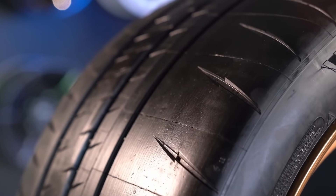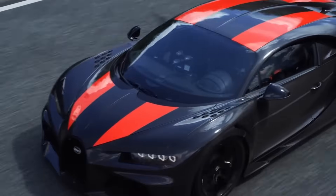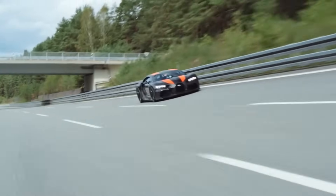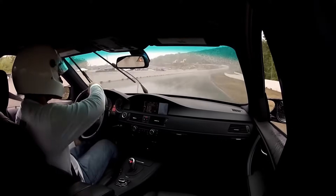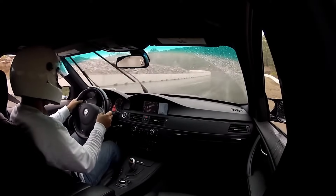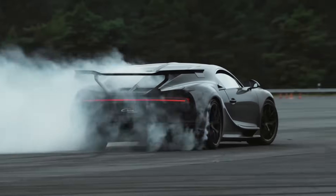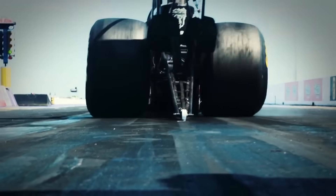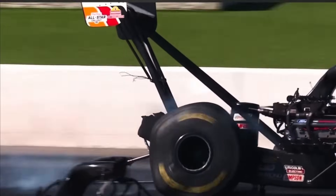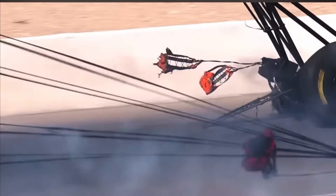This is what makes those Michelin Cup 2 tires — the same ones that allow hypercars to reach speeds like this — pretty bad tires for everyday use. Building a tire this durable comes with a load of problems. Beyond not being able to get the Cup 2 up to temperature on the street the same way your regular commuter tires will, if you get caught out in the rain with them they're outright dangerous. You need to make sure the tire remains usable for all kinds of road and weather conditions while lasting a reasonable distance. If Michelin designs a tire rated for these speeds, they need to make sure it can do it more than once — it has to be able to go this fast again and again. A completely different challenge than that faced by Goodyear when designing these giant one-off tires for dragsters, where safety and longevity are a lot lower on the priority list and the operating window is so much smaller.